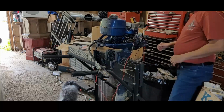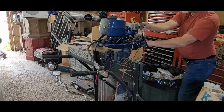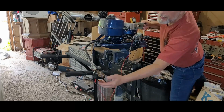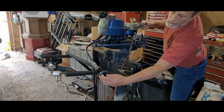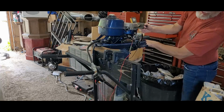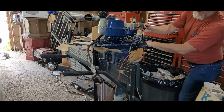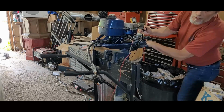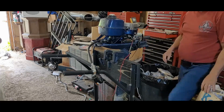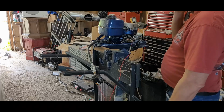I'm just going to double check it again while you're here. I figure you pull it about 5 times, it should get you the maximum amount of air. On that first draw, that took it to 60 PSI. That took it to almost 100. That's 2, 3. That took it to 120. Sitting at 120. Sitting at 121. All right, so that should be enough. It's sitting at about 121 PSI. That's really good. We got no problem with compression.